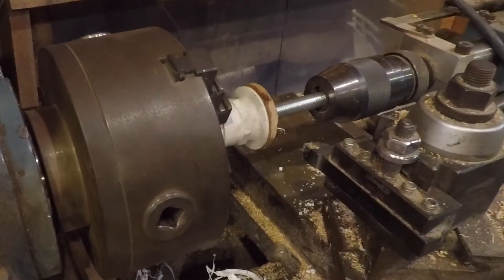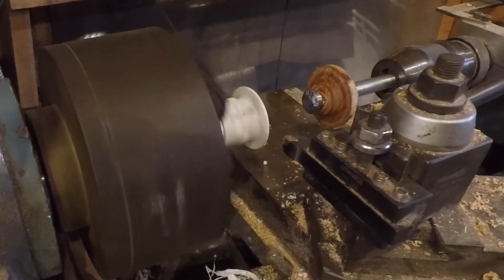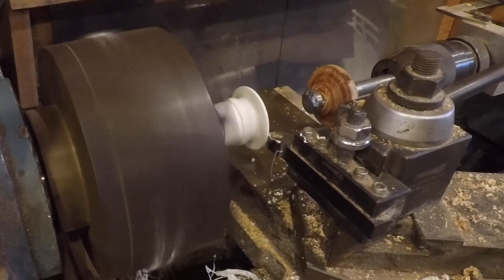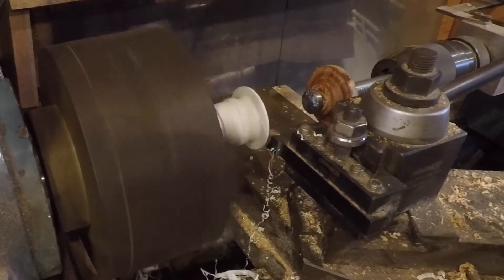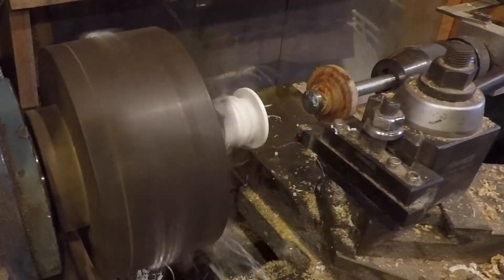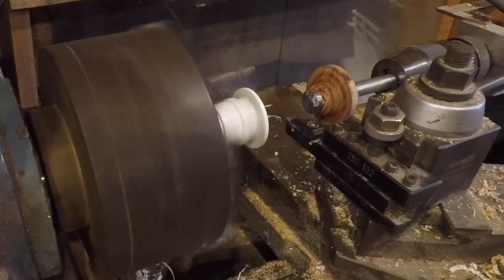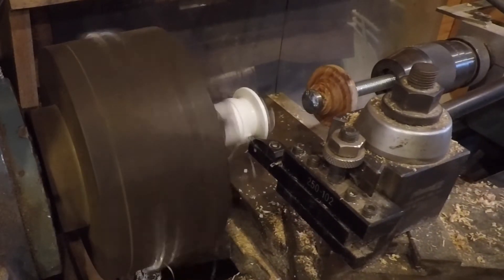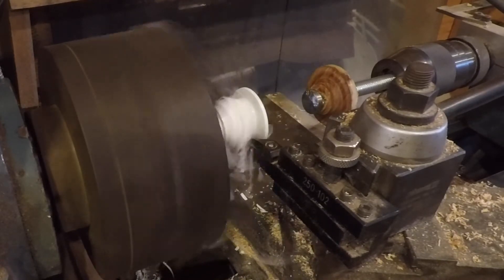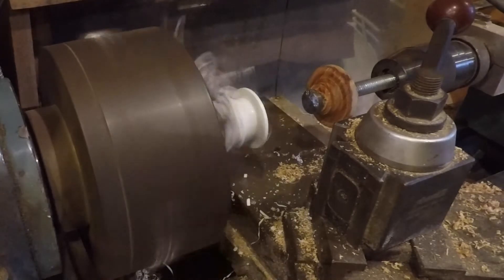I use this technique anytime I want to make a flanged part — for example, making wall bushings for the camper's two-and-a-half inch walls so water doesn't permeate into the wall interior. I can make a mating bushing from the opposite side to get a very good seal on a passage through the wall. After the part cools for several minutes, I use the tool to ensure a broad flat surface. There's a hex nut on one side that interferes with having a nice round flange, so I take that off as well.